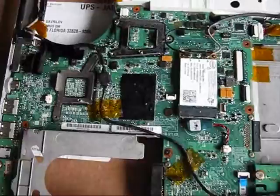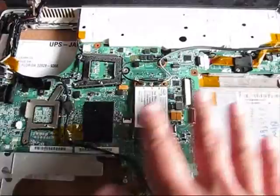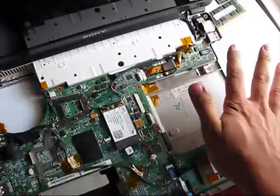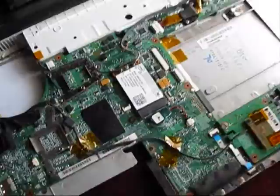Right now it's totally clean. I spray it with an alcohol-based liquid — vodka in this case — and right now I will let it dry for a couple of hours. It's not regular water, that's why it will evaporate very quickly. Make sure that everything is totally, completely dry everywhere before starting to assemble everything back. I waited 12 hours to make sure it's totally dry with no droplets. I used alcohol liquid — it's not water, it evaporates almost right away.